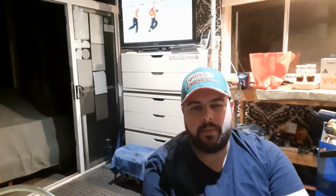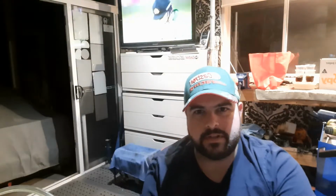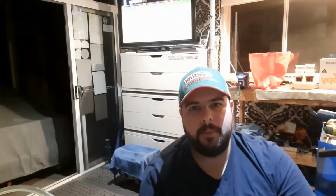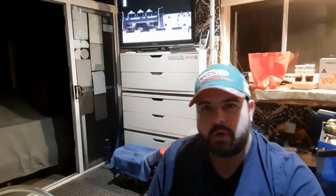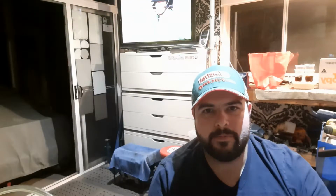Alright, thanks for tuning in to another vlog. We've still got a few bits to go. Timing belt, exhaust manifold, intake manifold, just bolt-on stuff really. With the timing stuff, we're just going to take our time and make sure it's done properly. No one wants to have a whiny timing belt and then have to pull everything apart and put it all back together. Super keen, sort of, maybe not, to try and fit this Koyo radiator in there with the shroud. Might have to cut the rad support, but we'll see what happens with that.